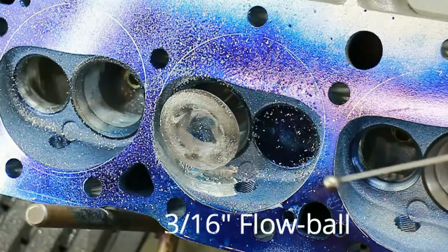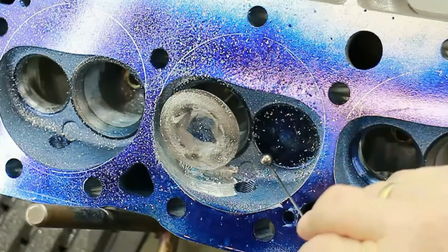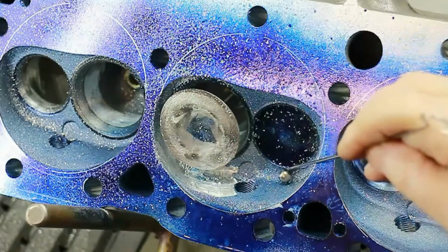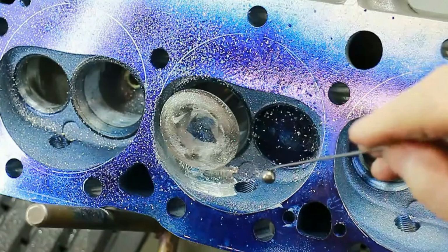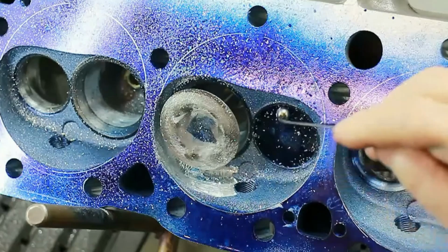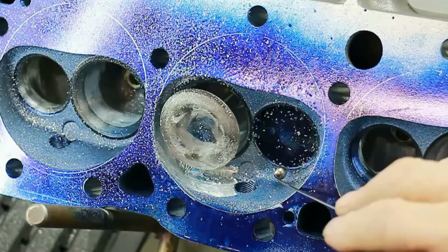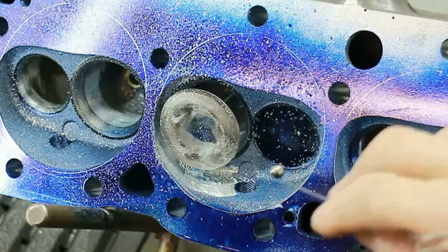On the exhaust, I'm only going to use this ball and I'll lift the valve by that much and clearance it by that much, and that's so that I can area rule the exhaust. When this exhaust valve first opens, the flow is supersonic. Doesn't care about discharge coefficient, only area available. So I'm just going to use this and that should cover the first 200 thousandths lift. I'm not going to take too much from here because the flow here will get too high speed and it will shut off this side of the valve and that will be a net loss.